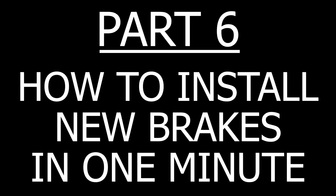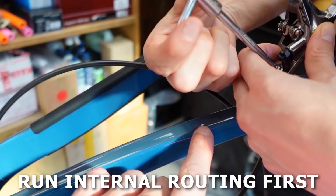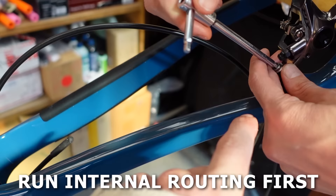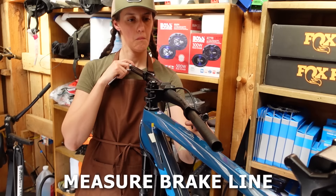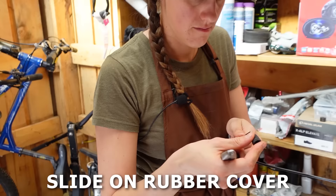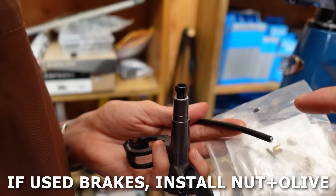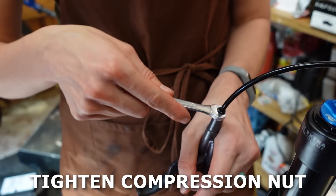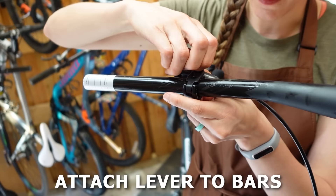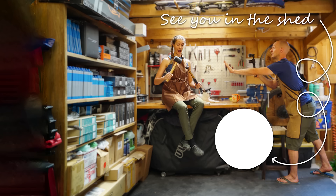And this is how to cut and install hydraulic Shimano brakes in one minute. First, install your caliper. If this is an internally routed rear brake, make sure to run the line through the frame before installing the caliper. Now install the lever in its appropriate location. Measure the brake line so that it reaches the lever and there's enough space for the bars to swing freely. Slide the rubber cover onto the line. Now cut the brake line and install the barb. If this is a used set of brakes, slide the compression nut and olive. If these are new brakes, those are already attached to the lever. Place the end of the brake line into the lever and tighten the compression nut. Now slide the rubber cover into place, connect the lever to the bars, place a shim between the brake pads, and do a lever bleed. We'll see you next time.